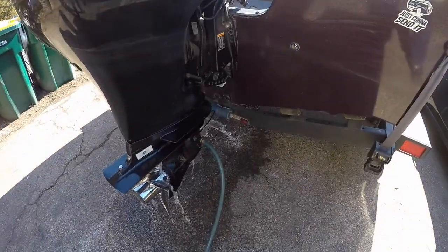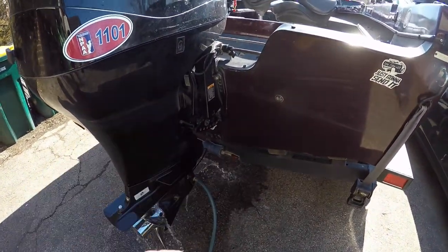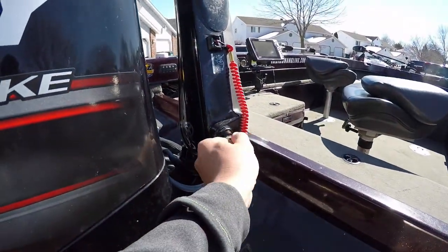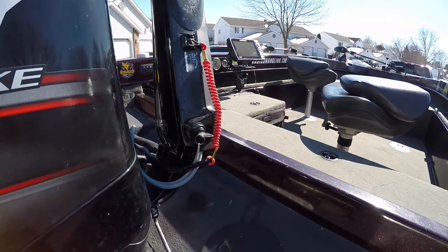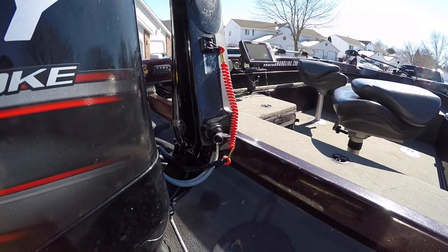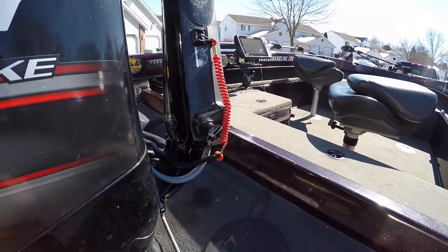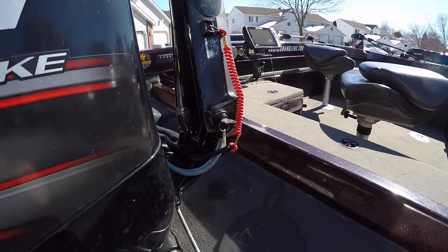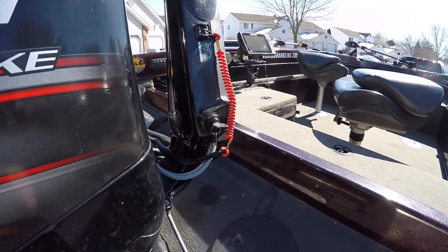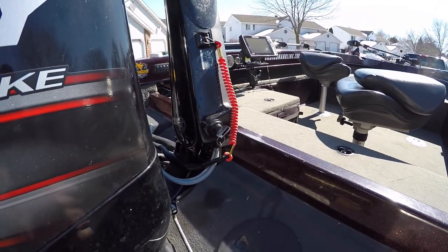All right, guys, we have full water pressure. Make sure you turn your hose on, full pressure, so we got the maximum amount of water making into the cooling system. First thing I do is I prime my fuel pump. All right, we turn the key, you can hear the fuel pump running. Runs for about 6 seconds or so. I'll shut it off. Give it a second. Prime it again. This way we're working any air out of the system, ensuring that this thing fires up right away. Do it one more time.